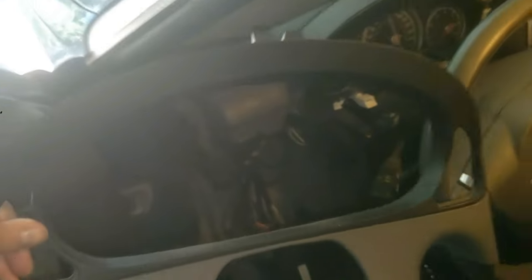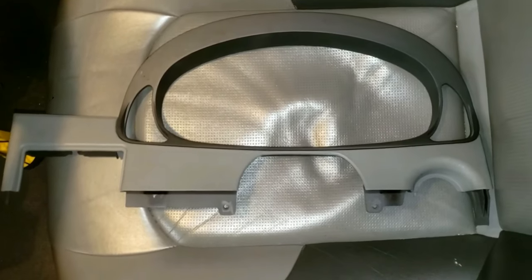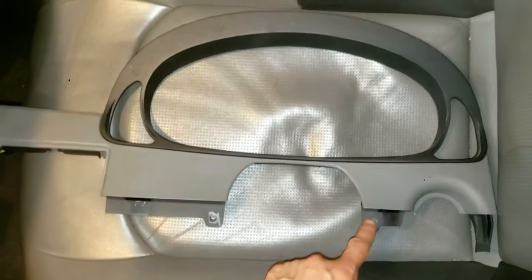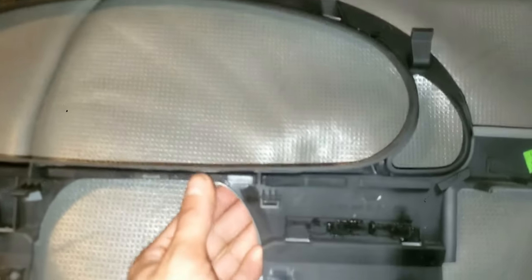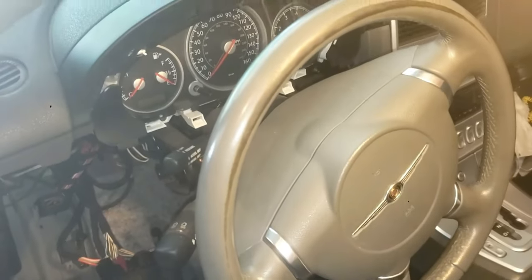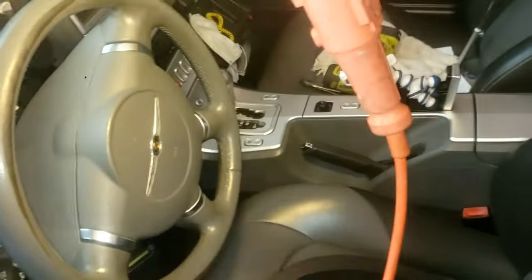You'll notice the clips all the way around. Reinstalling is actually much harder in my opinion, but I'll give you some helpful tips so you can get this in with minimal struggle. You can see the screw holes here, here, and there — that's three, and the fourth one is right there. This is how the back looks and the part number is right there — I'll put this in the description. You do not have to take out the steering wheel, but you do need to make sure it's pulled towards you as much as possible, going towards the seat.